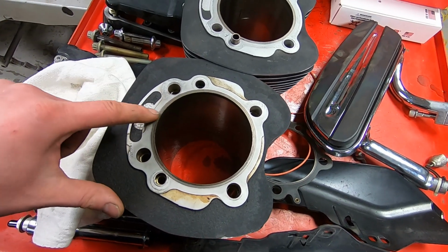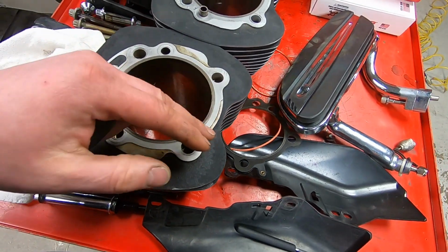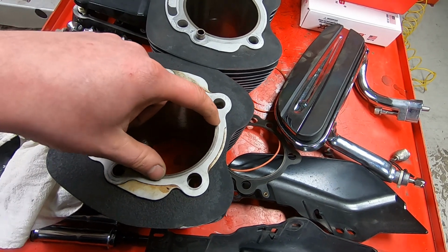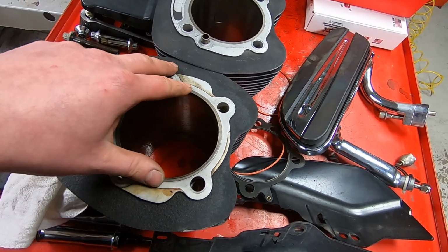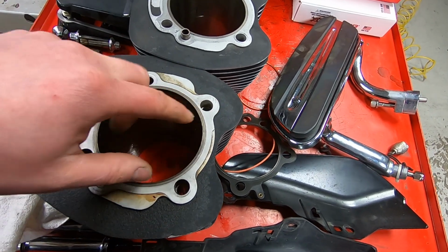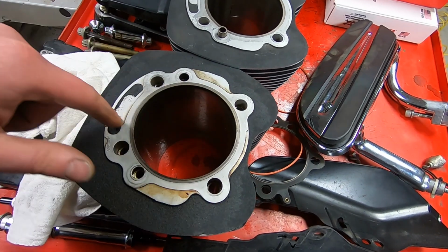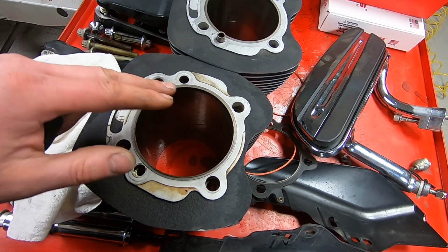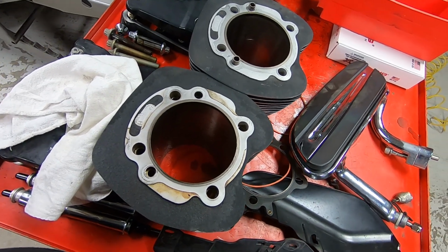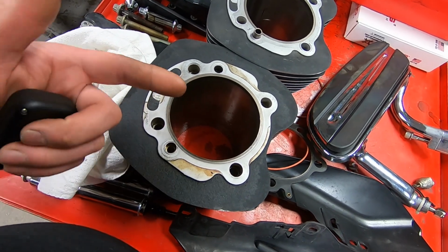We might as well try the thickest part first, but I want to cut through one side and cut through the other side and crack it in half, and then hopefully one side will pop off and we'll see the way that I'm assuming the inner sleeve is made first. That would make sense. And then the liner is cast around it, and there should be some casting grooves to mate the two together. But figured I'd bring you along and see if we can hog through this thing and see what it looks like.